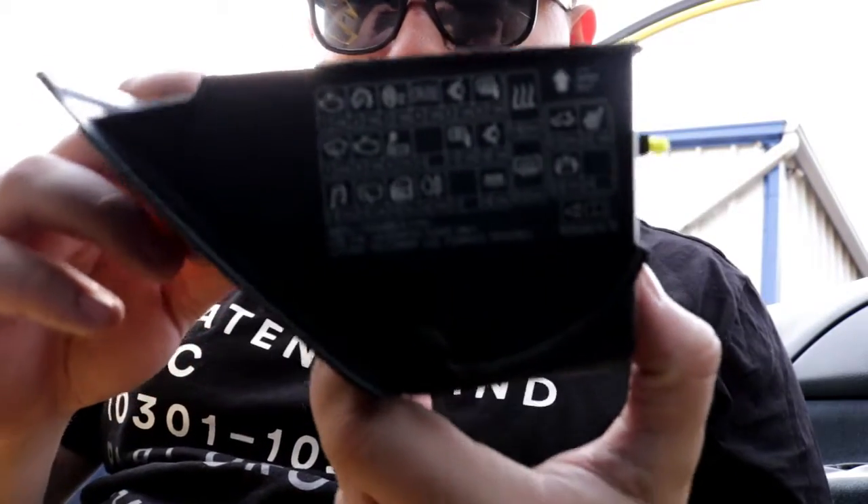Here's where we're at: there are a number of fuses that are the wrong amperage — which is the amount of voltage and amps that the circuit in question needs or can handle. I've been sitting here on the ground going in and out of the fuse area just to make sure this thing works. Note to anyone watching: if the manual tells you exactly what size you need, use that size. You are not smarter than the people that built the car.